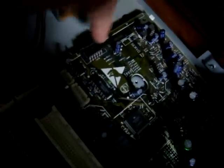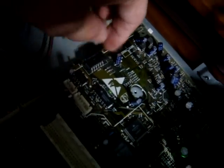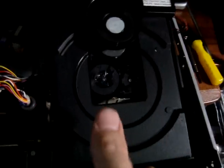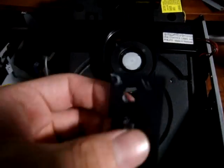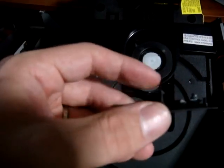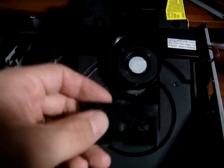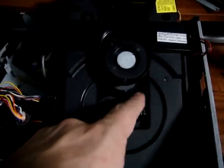One other thing I noticed when I went to take the disk drive out is where the ribbon goes — they don't give you much space to lift that up and slide the ribbon out. So this is something you really have to be careful of if you're thinking about cleaning your disk drive and greasing those parts up. You're going to have to disconnect this ribbon cable up here and just be really careful when you do it. To get access to the spindle unit, there's a small little panel that you just have to pop off — it's just got a little clip on it. You can slide a flathead screwdriver up underneath there and pull it right off. You don't have to remove the tray; there's enough clearance to pop it out. Even if you wanted to remove the belt and change that out, this is what you have to remove first.